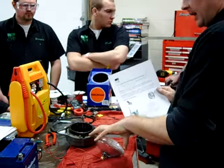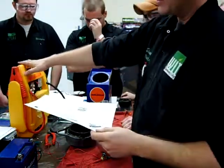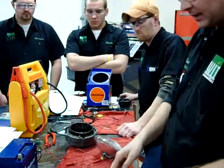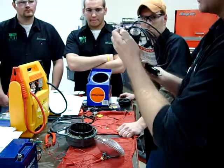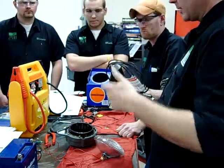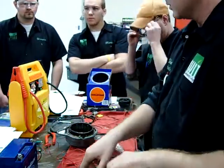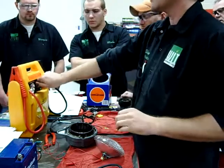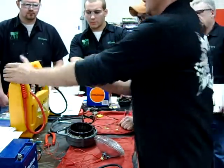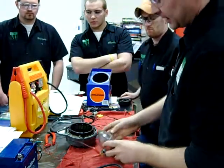We're going to take this headlight on high beam and we're going to shove 5 amps through this. We're going to need a battery source. We've got a couple different ways we can do this. You guys have all seen in your toolkits that you have this remote start. We don't want to just start hooking stuff up — we want to be controllable. That's why instead of using a battery and a remote start, we can use a jump pack because we have the on/off switch. So we can go ahead and wire this whole thing up, just clamp onto our leads right here off our battery pack, and duplicate the system.